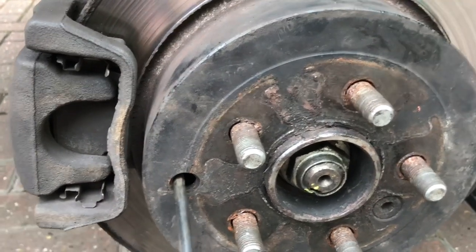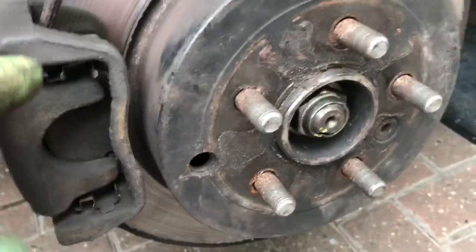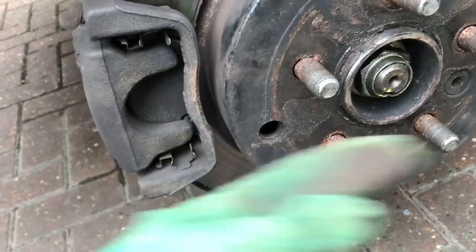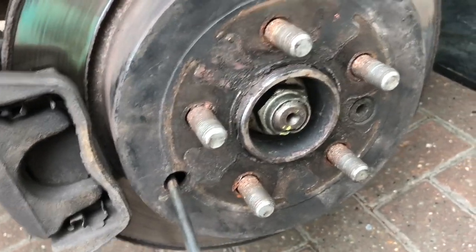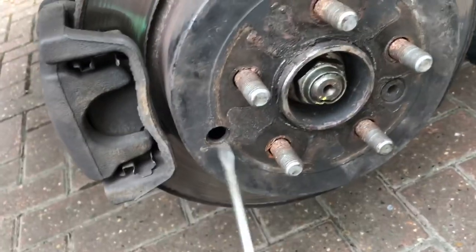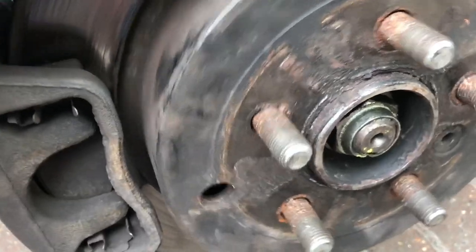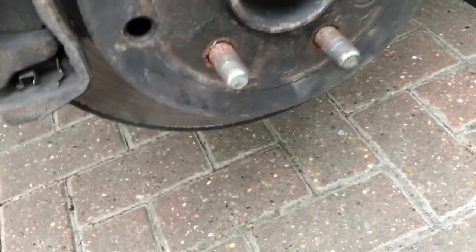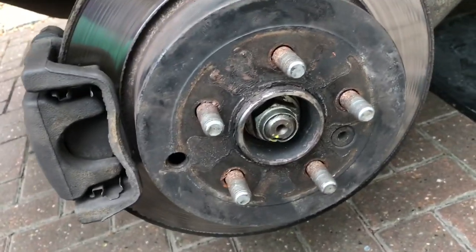On the driver's side you have to go the other way — flicking it that way. So what I've done is adjusted this. On the driver's side you have to push the wheel the other way, to the rear. I've just flicked that one more turn. That is now solid — okay, that's too much, that's now binding. So I'm just going to back it off one click. There we go — it's just starting to rub. You can hear it rubbing. I just don't want too much rubbing to build up a load of heat.